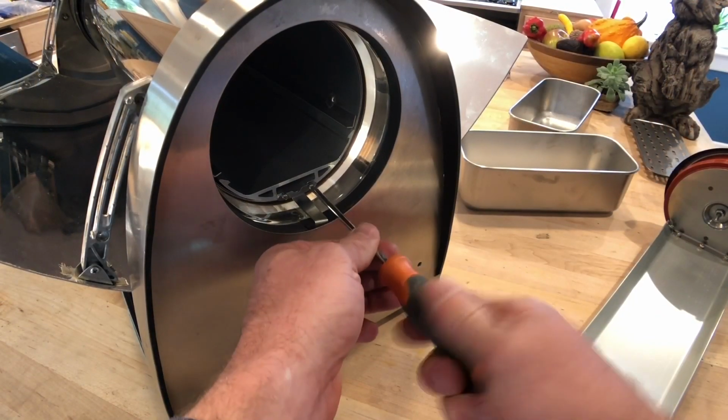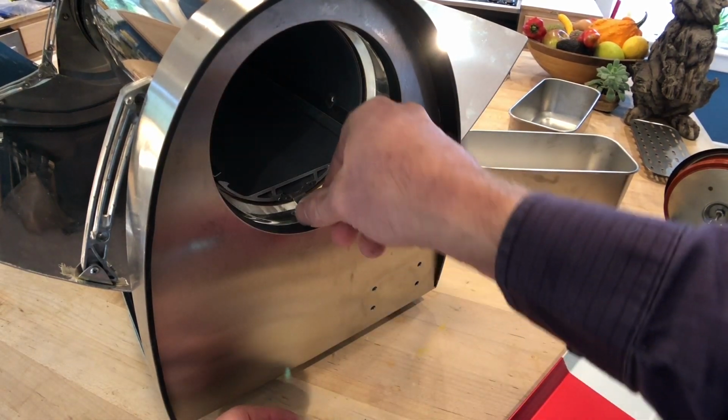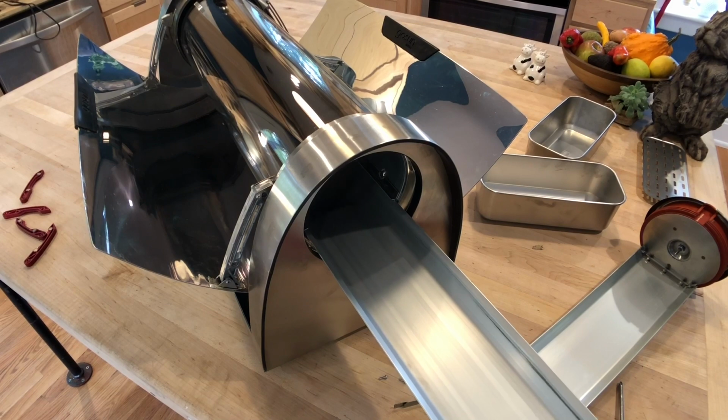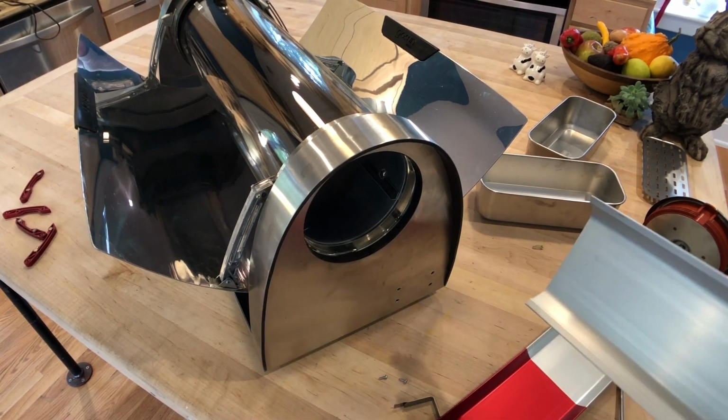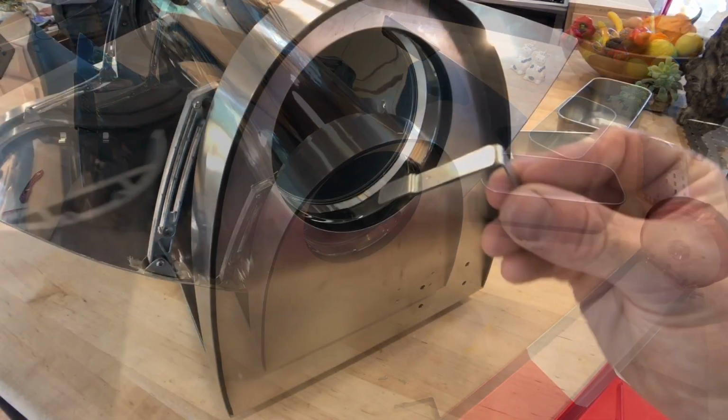Finally, to remove the heat bank insert, use the same small screwdriver to take off the metal tab at the bottom of the tube's opening. The tab is removed by lifting vertically. Slide the insert out of the tube completely. And you're now ready to get cooking.